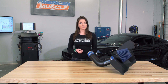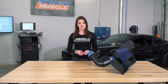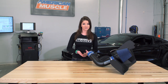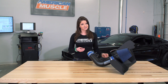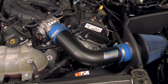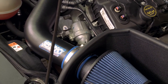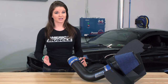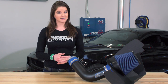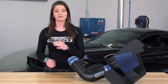The main benefit of a cold air intake is increasing airflow to the engine and providing improvements in power and acceleration over the restrictive stock airbox. This usually means a large filter and a large air tube. What you tend to see in more budget-friendly options like the BBK here are intake tubes and filters that are not as large as some other options. So you can't expect as much performance, and that's something we definitely saw on the dyno, especially with how well the factory air intake setup works on the S550s. All of our gains on the dyno were from that Bama tune. One other thing I'll mention is that the power curve is not as smooth as I would normally like to see, which tells me the air delivery with this intake isn't as smooth as other aftermarket options, and the tune is working to smooth a lot of this out.